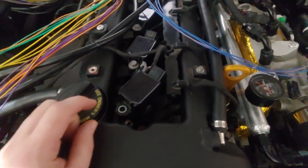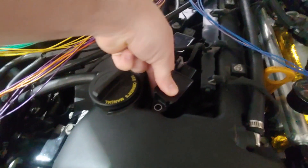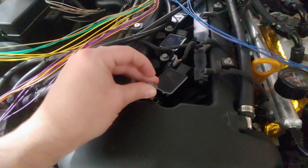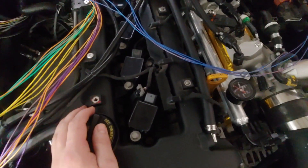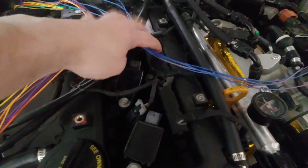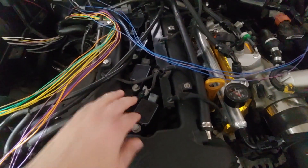The height matches so you can still push them down in place, and you can use obviously the same mounting bolt. This will work for BK1s and BK2s, but I have a BK1. There's a mounting bolt here for this cover for your wiring harness and then another bolt back here — essentially those have to be shaved down a little bit and then these will fit.